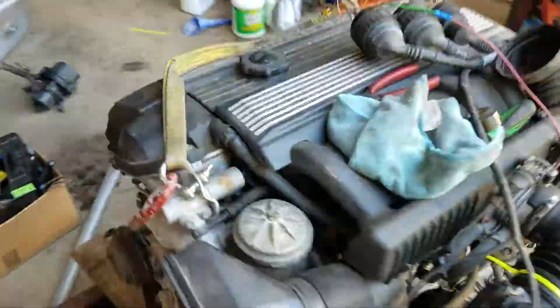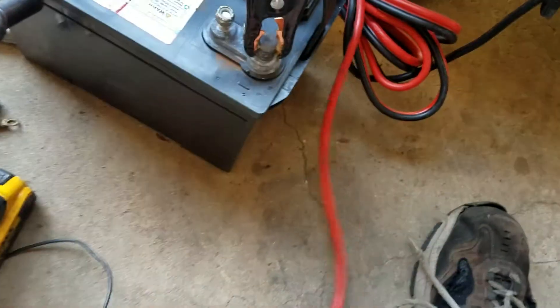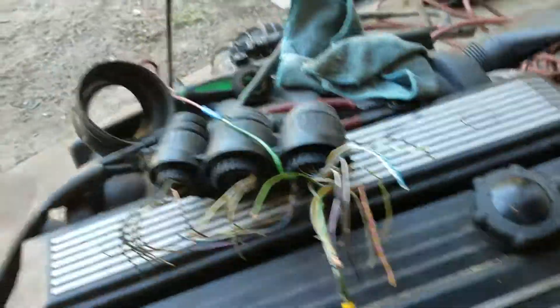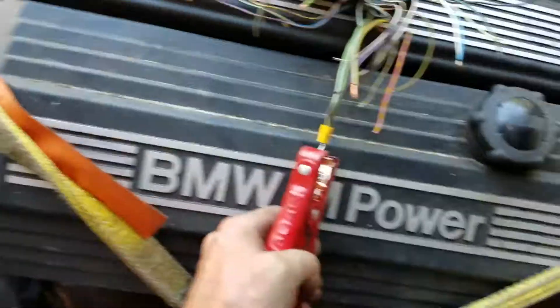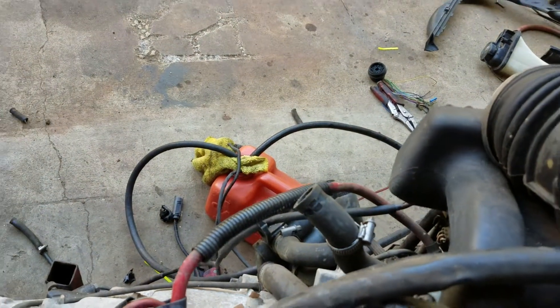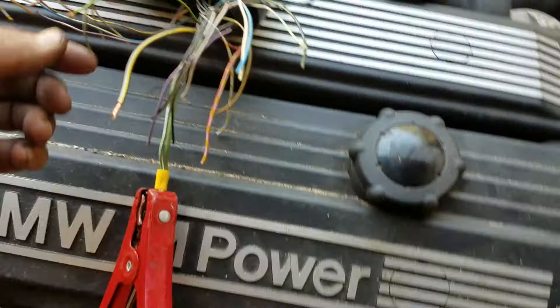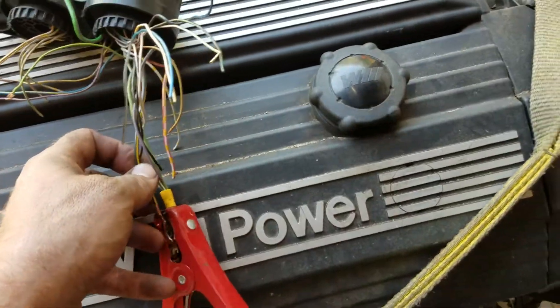Let's go over here and get my jumper cables. Alright, hot — so listen real carefully. I'm gonna touch this on the hot terminal and you'll see the fuel pump just kick on. Hook that up, then take your black and yellow and touch.